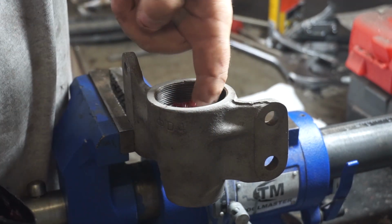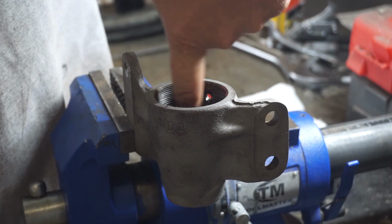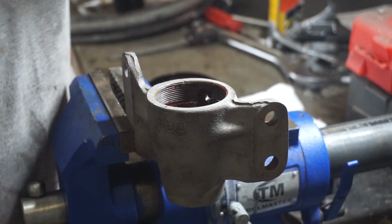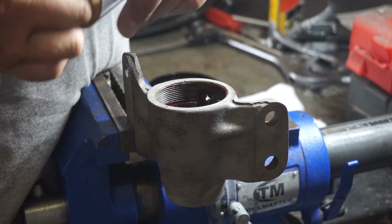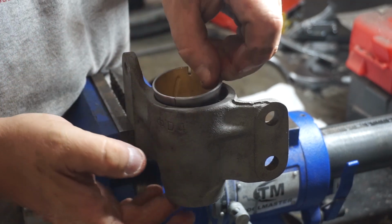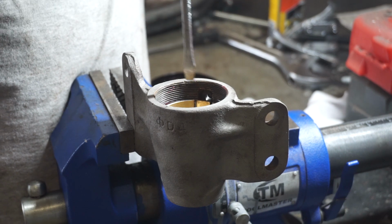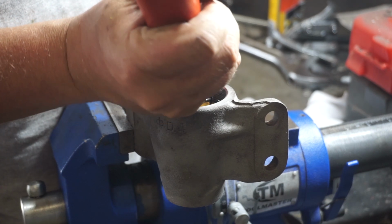So I'll lay a bit of grease in there first, even though that arm doesn't actually run on that surface. If it ever got water past that seal, and the water got in between this housing and that bronze bush, I'd imagine it would be carnage. Okay, there's our bronze bush. Put a light smear of grease on that. Pop him in with that detent tab towards the Zerk fitting, because that's how I pulled it out. Okay, let me tap him down a little. Now, that was bent inside that Zerk fitting. So, I will do the same.